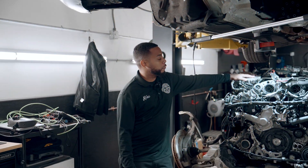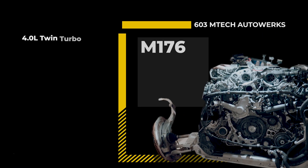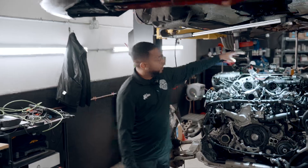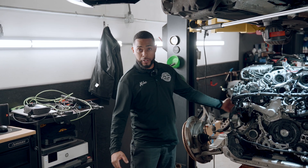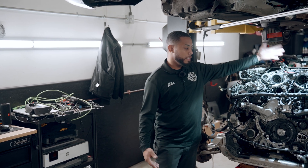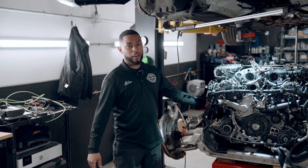This is a four liter V8 twin turbo. It's a hot V, so you got your turbos on the top and you got your intake manifolds on the side of the engine. Typically on your M278, you'd have your exhaust manifold here and your intake here. So turbos are a lot easier to change, but your intakes are a lot harder to change.